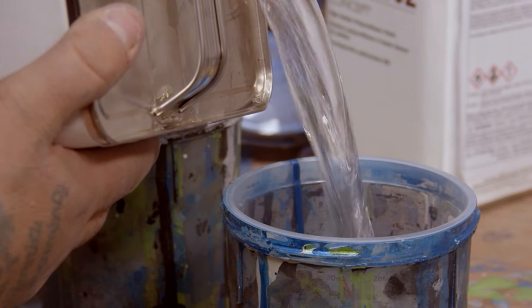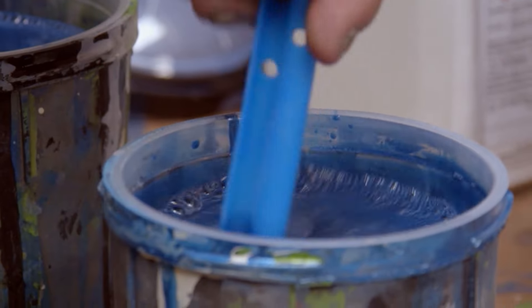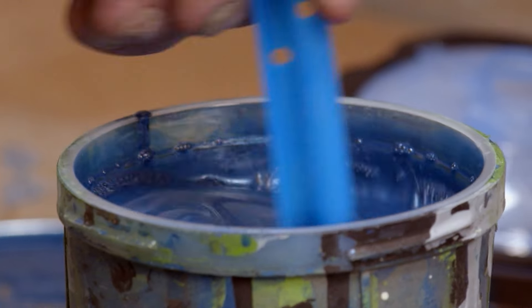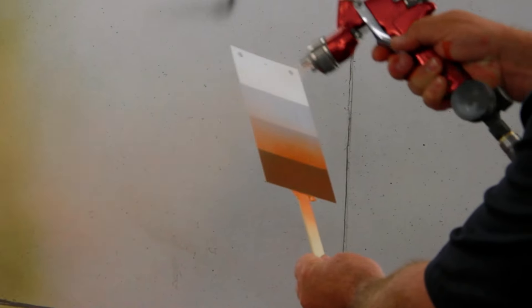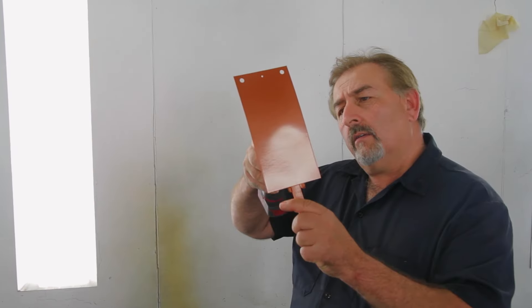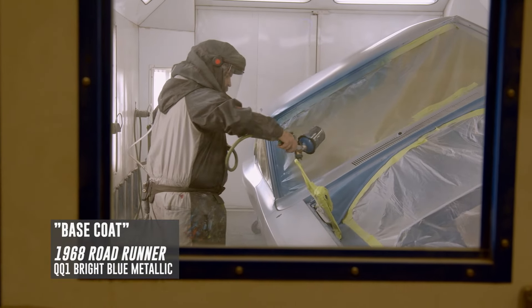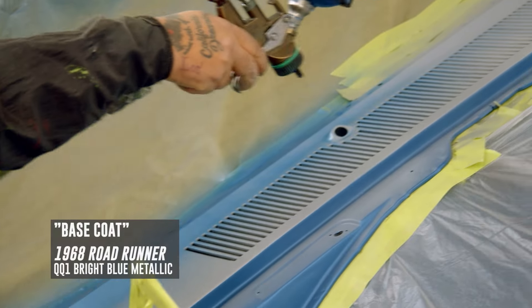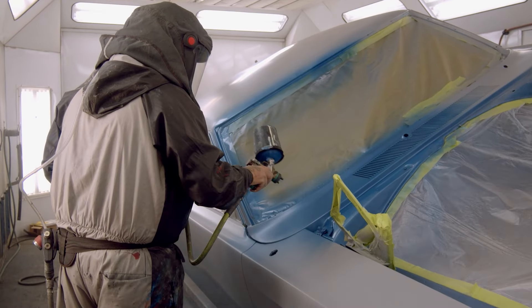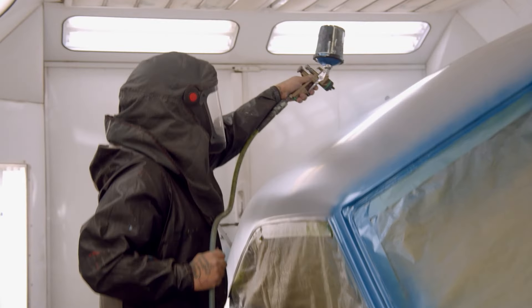QQ1 is a very bright blue metallic — pretty color, a little darker than V5 — but there's no pre-paint, so you can't just throw a couple of coats on and be done. In these blues and greens I've noticed it takes seven to eight coats to get complete coverage. I have to go back to doing spray-out cards: four different variations of colors you could potentially be painting over. You do the spray-out card, cover it, hold it up to a light until you can't see through it — that tells you exactly how many coats you need. Because you've sealed it, you know there are no small imperfections. Put on seven or eight coats of this transparent color, let it dry, then clear it.